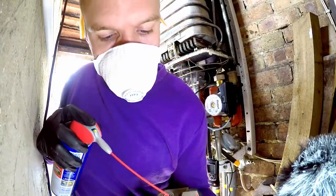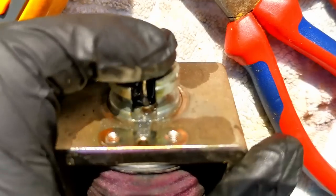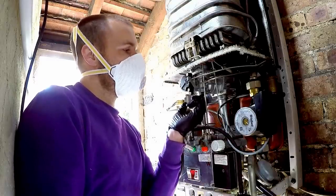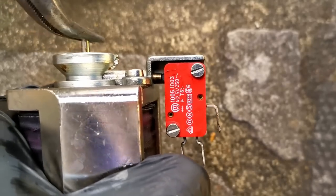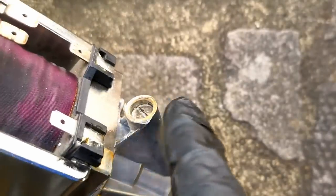I'll use a little bit of WD-40 to try and free it off. I took this micro switch off, and then we've got this moving - got that sorted, I think. Hopefully that's fixed. So this adjustment here is how long this takes to go from high flame to low flame - it does something with the fluid inside. Let's put it back in and see if we get high flame.